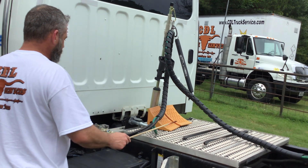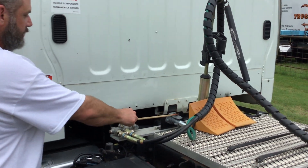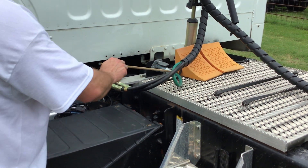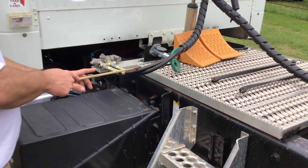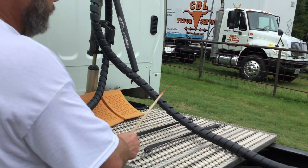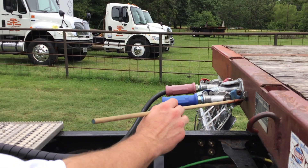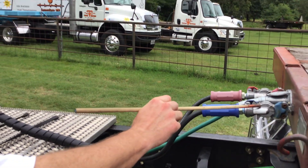From there, we'll continue moving on. My electrical line is properly mounted and secured. All nuts and bolts are present and tight. My latch is present and in place. My electrical line prongs are not bent or broken and are free from debris. The electrical line itself is not cut or spliced. My service airlines and emergency airlines are properly mounted and secured. All hose clamps and fittings are present and tight. They have no abrasions or cuts. I have plenty of radius in my service lines and electrical line for turning. My glad hands are properly mounted and secured. All nuts and bolts are present and tight. They're not cracked, bent, or broken. My rubber seal is not cut, torn, or frayed. It's free from debris, and they're not leaking.